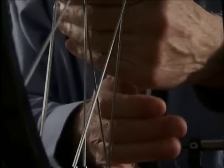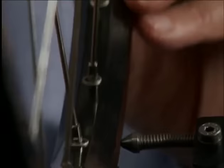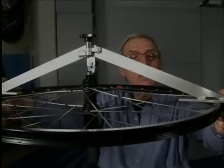But if a wheel is trued professionally with high optimal spoke tension, as much as the rim can bear, then the work is more demanding, harder, and more time-consuming. The rim becomes stiff. It fights back and hardly reacts. Small tolerances are then harder to correct.